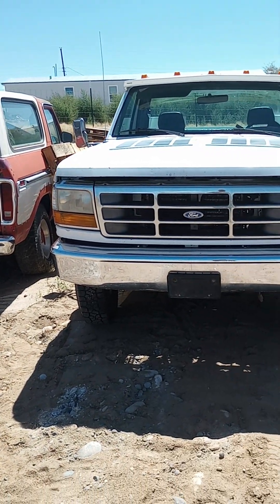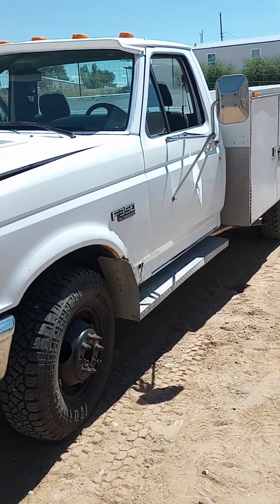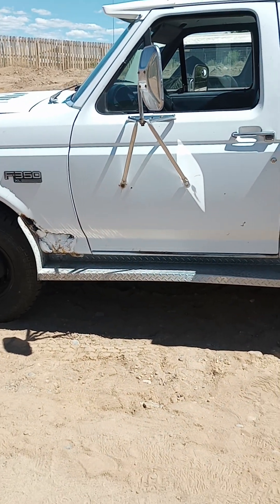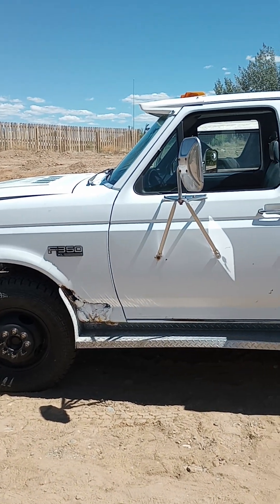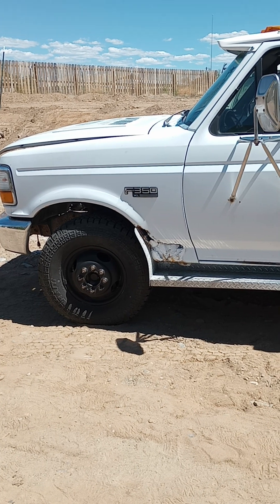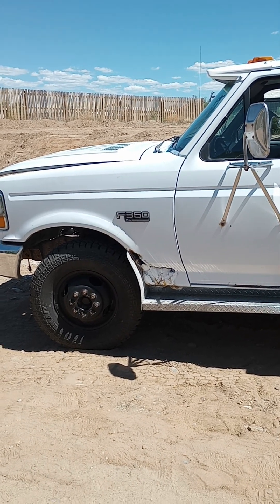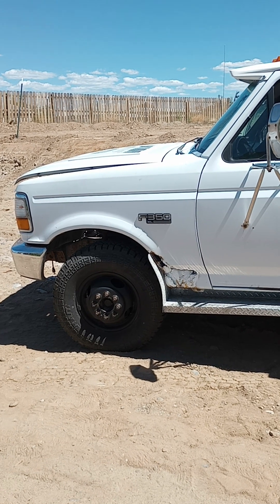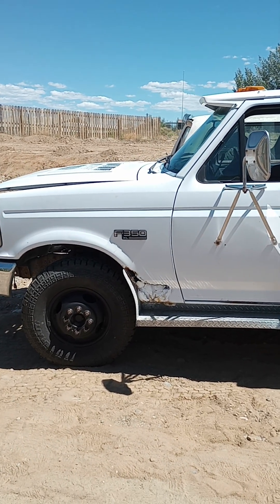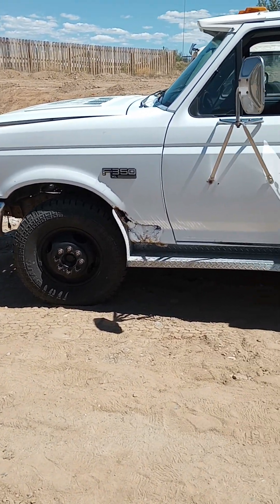This is going to be the starting platform — it's a '95 Ford F350 XL dually with a utility bed. The story on this truck is it was owned by a city, then a guy bought it and used it as his work truck. A rocker arm slid off the push rod for one of the intake valves and stuck the valve shut, then it blew the rings. It has Edelbrock heads and headers, 165,000 miles on it. The tires are basically brand new — only a thousand miles on them.